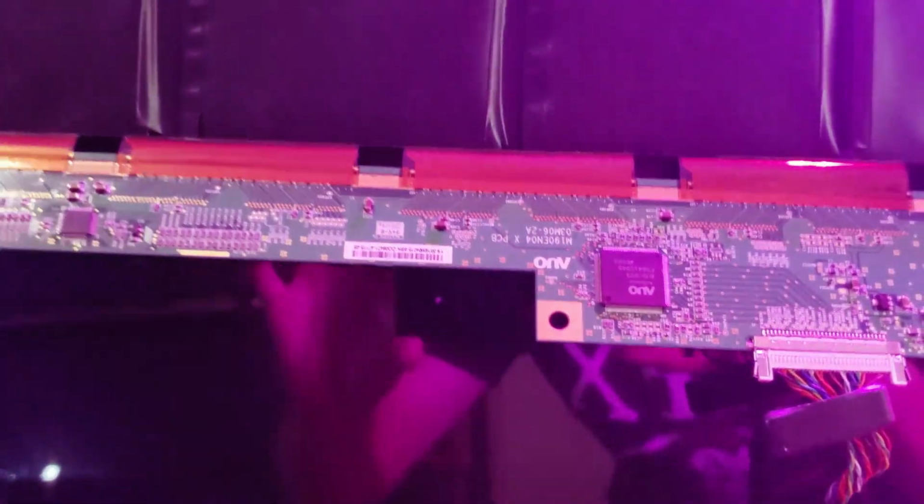You want to be delicate too with these wires because they will break. That's what happened to my first one I did. I put it on the bottom of this monitor, flipped it the other way around with the wires at the bottom, and when I took it out, it broke. So it was not the greatest idea, but hey, that's what you do. You learn from your mistakes. So I also recommend having 2 monitors, so if you mess up, you can try again.